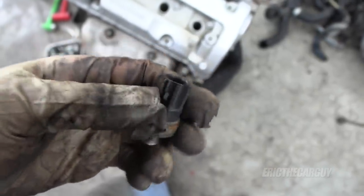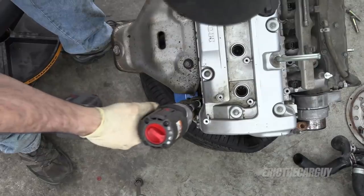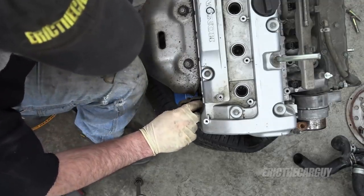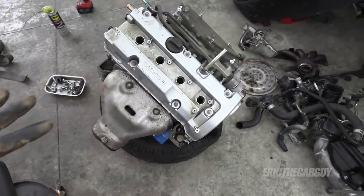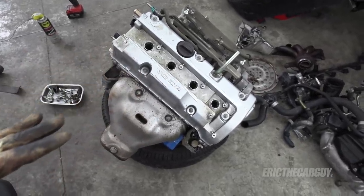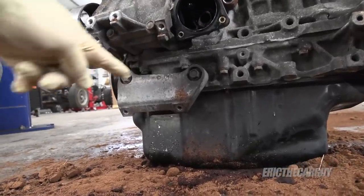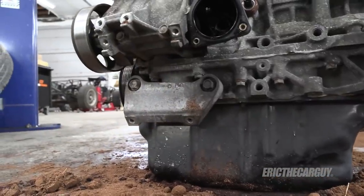Remember this sensor that I removed? That's going to go right where that plug is, so I'm going to swap that over. This one still has the seal intact on it — I don't want to double gasket it. The clutch won't be here until tomorrow, but there is something I can do: level the engine back out and then remove the valve cover and the plugs and do a valve adjustment on it. There is something I forgot to switch over, and it's this right here — this is not on the new engine. It's just these two 14s and it's mine. It's the lower mount for the AC.